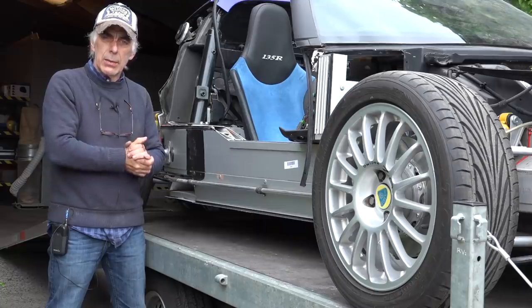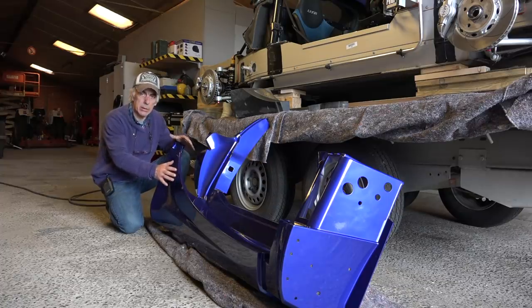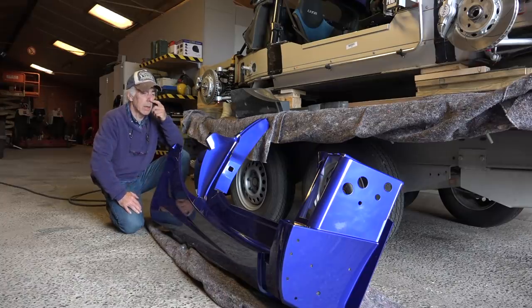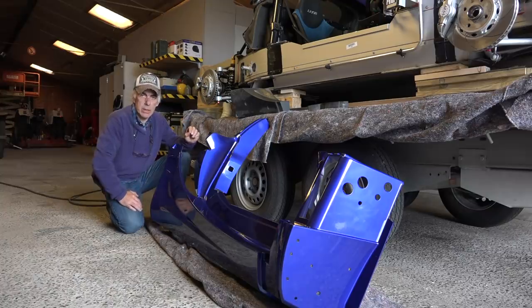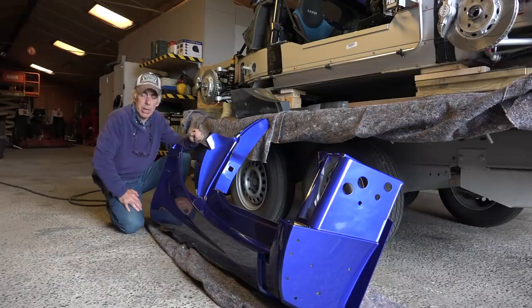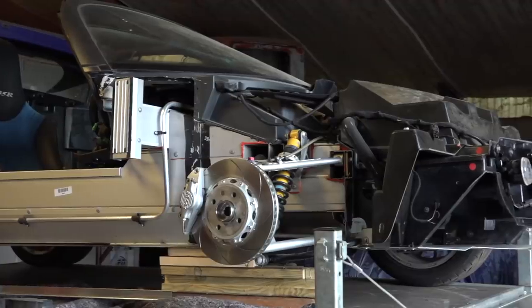The first thing we're going to do is trial fit the painted new sill. You're probably wondering why, since I already have all the markings on the vehicle from before painting. There's a good reason: there is a bracket we have to build in the back of the sill. New sills, for some awkward reason, are missing a piece of polyester material to attach to the back of the vehicle, so you have to order a metal bracket with it — and I didn't know, so I didn't get one. No problem — I'm going to make my own aluminum bracket.